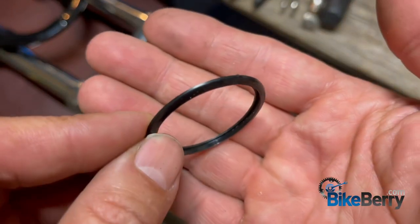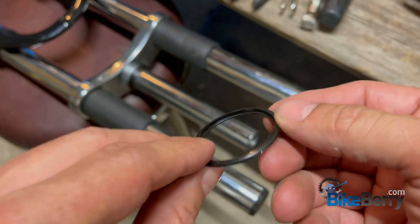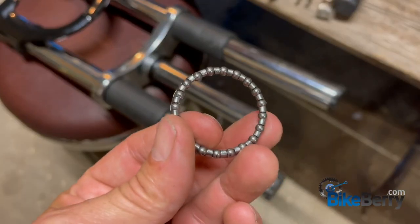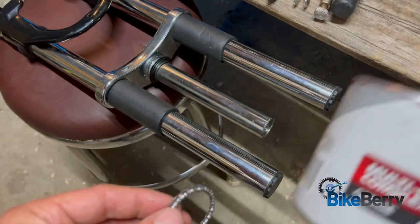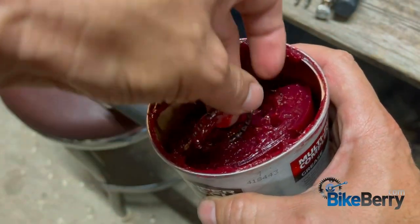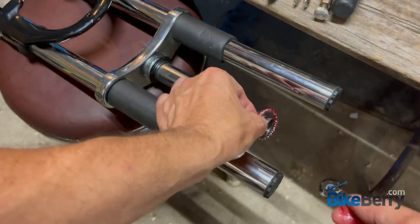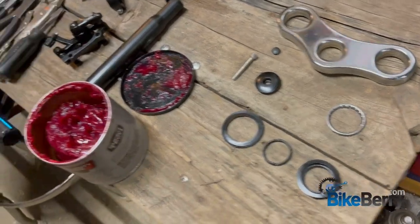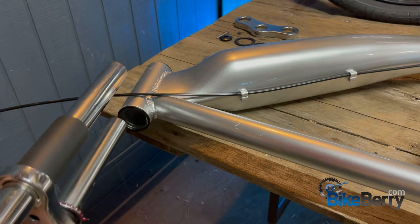So let's start with the order. This is a beauty ring — see how it's shiny on this side and looks like the inside of something? That's because it is. You want to take this first ring and put it on here like that. Then we're going to take our bearing ring. See this side of it with the race? Put some grease on it like we've done in our other videos, work it in there, and put the race side towards here. Then we'll get it right into the frame headset — this bracket here goes towards the front, just like this.